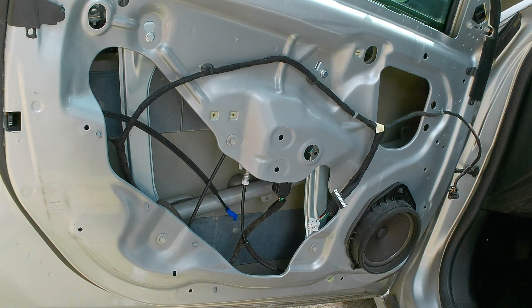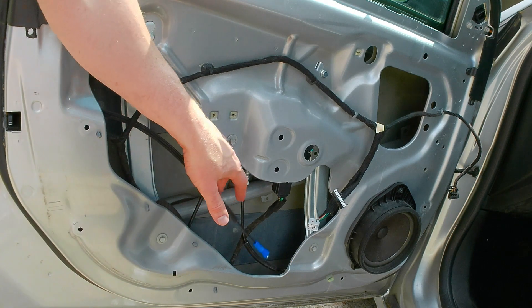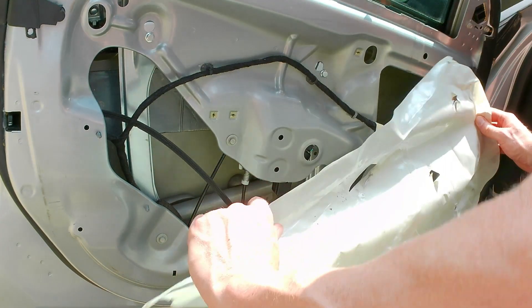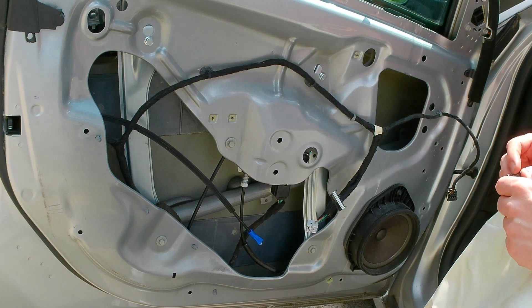Remember — as I mentioned in my torque wrench video — you'll snug this up first because even though the torque wrench works like a ratchet, you don't want to just twist and twist; get it somewhere to start beforehand so you don't shorten the life of the tool. Torque down to 80 inch-pounds. Make sure the torque wrench is backed back down afterward. Make sure the cable is out of the door and put your plastic piece back on, starting with the bracket.